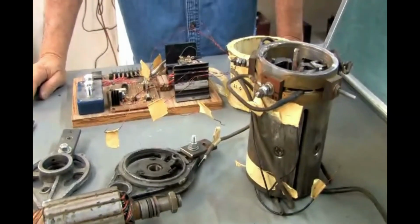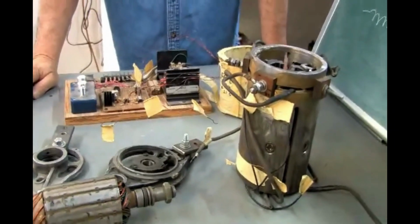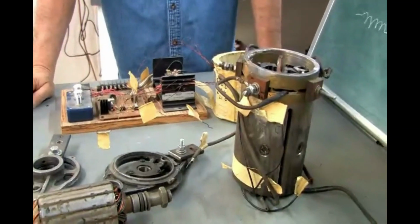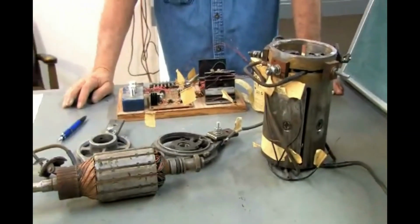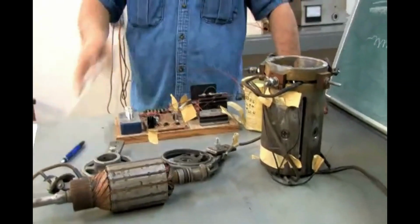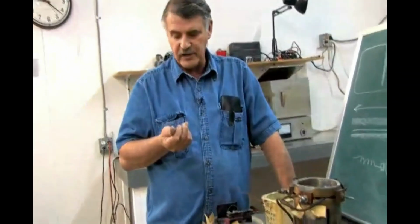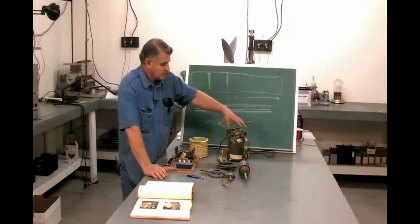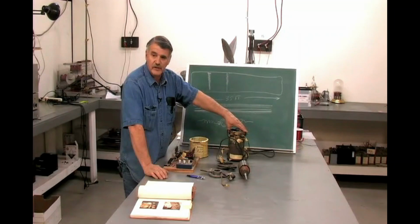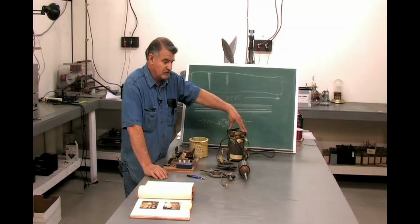From the original machine. And the original machine was a Bosch generator, which was a 6-volt machine, and of course they needed a 12-volt generator, so they tried all kinds of 12-volt generators. They tried Ford, and they tried Chrysler, but the only one that would work was this Delco Remy, its case and the way it's arranged. It's the only one that would work.